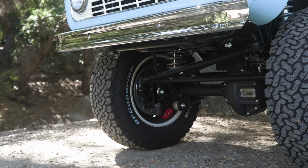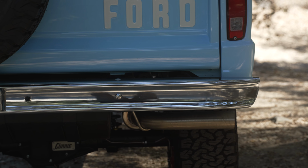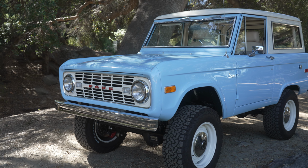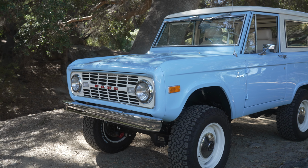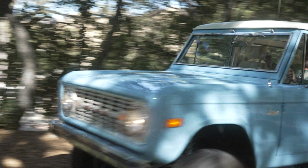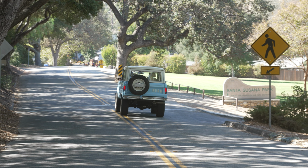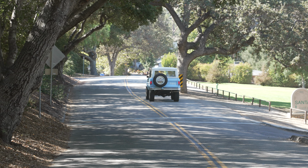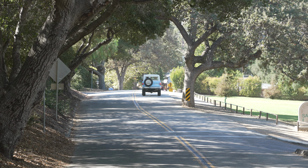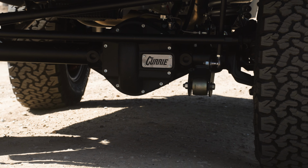This truck features the restrained, using the term lightly, mandrel bent stainless steel exhaust system built by our friends at Borla. We're running a bespoke to Icon, with hardened shaft and other internal upgrades, but robust and super simple Ford AOD 4-speed automatic with overdrive, which in turn is sending power through to the Atlas 2 twin stick shift on the fly part-time 4-wheel drive transfer case, 1310 U-joints, JE Reel shafts to the Dana-based axles.